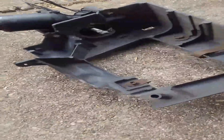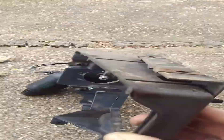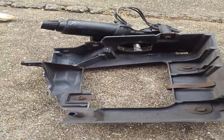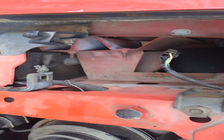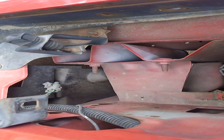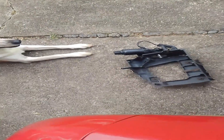There is our bracket with the headlight motor out of it — broken tip right there as you can see. Nothing too difficult to get to. It's just a basic sheet metal, pot metal type bracket. That's my shop helper over there — he sits and watches me do this stuff. He's not a bad dog, just very tame. Anyway, here's the opening with the headlight assembly out — there's really not much to it. The headlight assembly bolts right to the radiator support, so I'm going to go get my replacement piece and put the headlight motor on it.